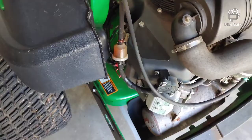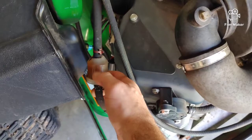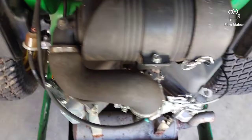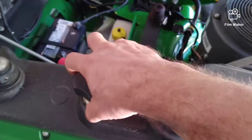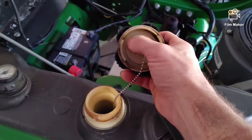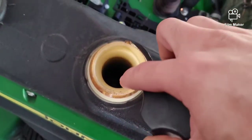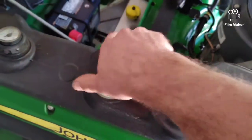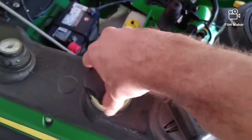The next overlooked item that would cause lots of problems would be the fuel system. You've got a fuel filter that people would never change, and you'd get trash possibly messing up the fuel pump, carburetor, and engine. One other thing to look out for — these gas caps. A lot of these gas caps are missing the o-ring. If that o-ring is missing, I can guarantee there's dirt, and if you're down here in Florida, there's probably sand in there too. So if you go to buy a used mower and you pull that gas cap off and there's no o-ring, you can almost guarantee there's going to be trash inside that gas tank.